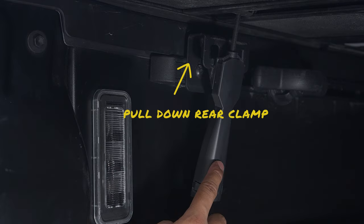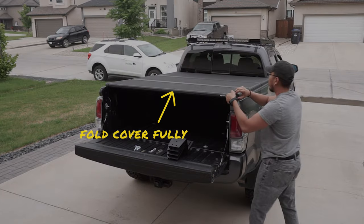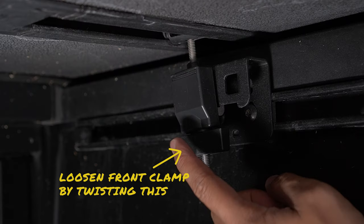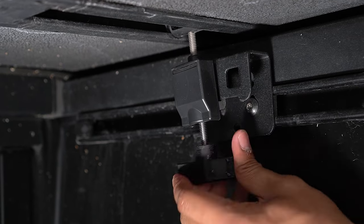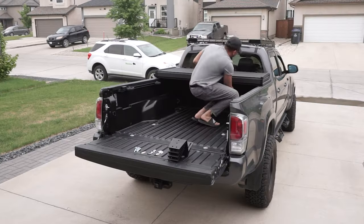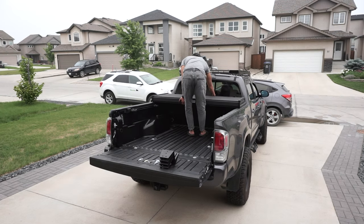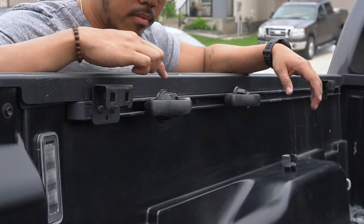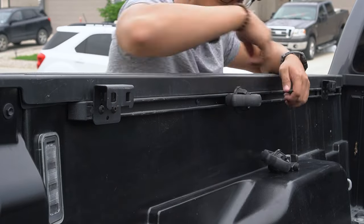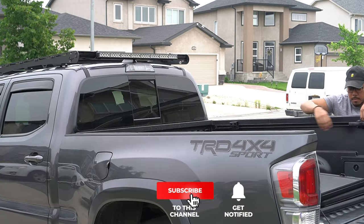To remove this, pull the rear clamp down and slide it to the side. Then fold the cover fully and lock it into place using the locking straps. When that's complete, loosen up the front clamp to remove the cover completely — twist the black tab out, then release the jaw by pushing the tonneau cover up slightly. Repeat on the other side, then simply lift the cover off the cab and place it to the side. If you have bed cleats on your Tacoma, you'll also need to remove these, as they will be in the way of the backing plate sliding along the bed rail. Simply loosen, twist, and pull out, then repeat on the other side and put the bed cleats aside.